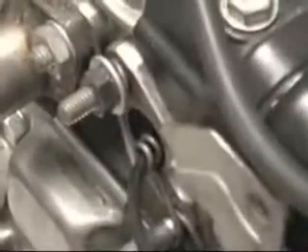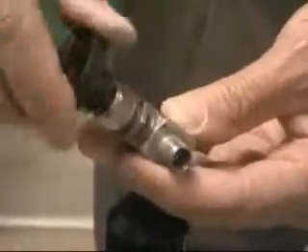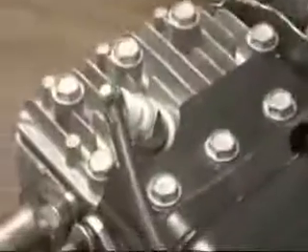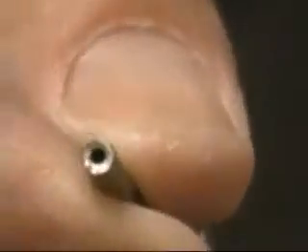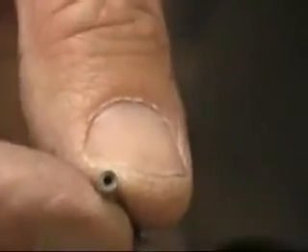We're doing the engine power control with a metering valve, which is a needle type valve common to the instrumentation industry, where it would be used for controlling the flow of nitrogen, oxygen, or hydrogen in a lab. It's sized for delivery on an eighth-inch tube, then cut down to an even smaller diameter at the point of injecting — about a sixteenth inch at the point of entry. As an example of the size of orifice we'd use for delivering the hydrogen at the intake port on a very inexpensive conversion.